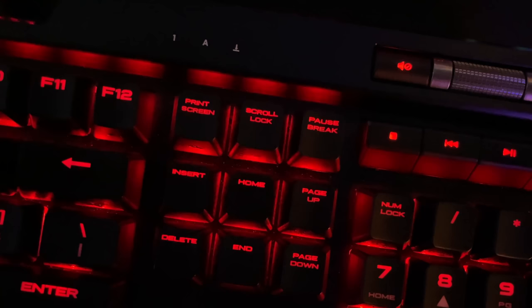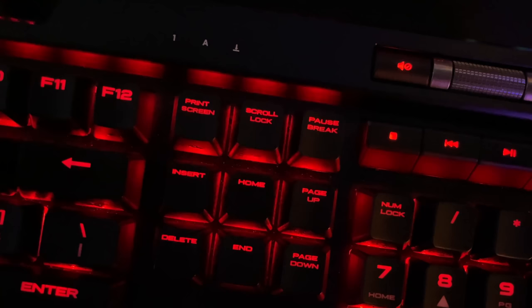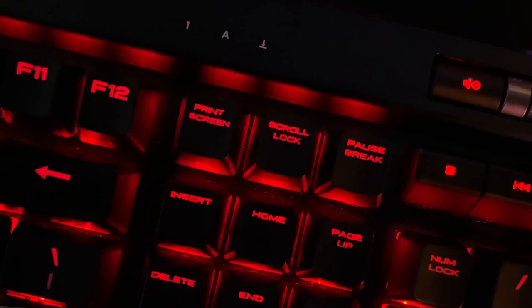On a PC keyboard, the ScrollLock is actually a toggle key, just like the NumLock and CapsLock keys are. And just like those lock keys, because they have a state — on or off — it is usually accompanied by an LED indicator intended to show its state. But what does that state even mean in the case of ScrollLock? Well, it can vary depending on the application, because unlike NumLock or CapsLock, it does not modify future keypresses. Rather, it's up to the operating system or the application to check the state of the key and modify its behavior accordingly.